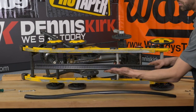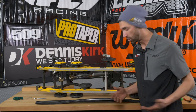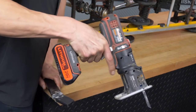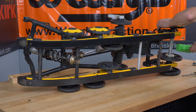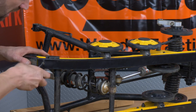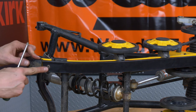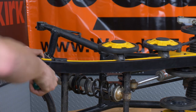As you can see, this is the new slide compared to the old one and it does have a little bit of extra length to it — they're always going to come a little bit longer, so simply just cut it to length and then get it installed on the suspension. One thing that's really important is making sure that your screw gets snugged down really good. You want to make sure that it stays beneath the outer portion of your slide — you do not want that screw to come down and actually catch on any track clips or the track itself, as that's going to cause a lot of damage. So make sure she's snugged in place.